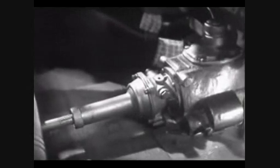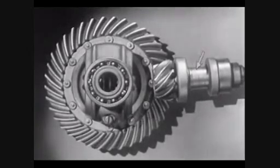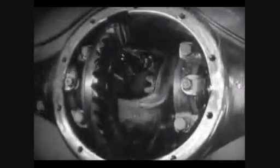Of course we could lower the floor and ceiling, but the drive shaft would be higher than the floor. This would have disadvantages — a shaft in the middle of the floor of an automobile would be inconvenient for passengers and awkward for carrying luggage. Today, engineers have found a way to make the car roomier and closer to the road without a clumsy shaft above the floor. The drive shaft from the engine to the differential is lowered out of the way, and connected to the rear axle at the bottom. The new low center drive makes the rear axle quieter, stronger, and more durable because it gives better, smoother contact between the gears.